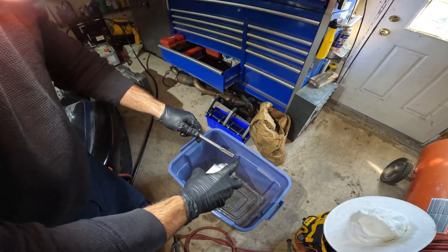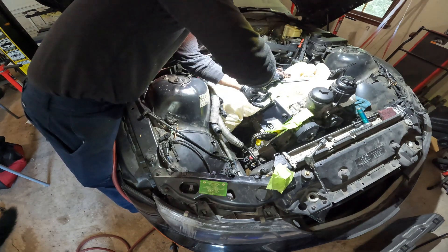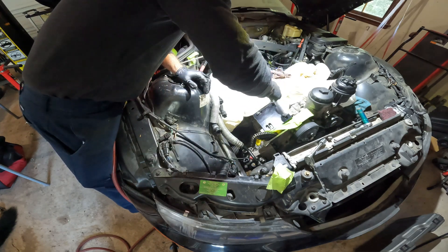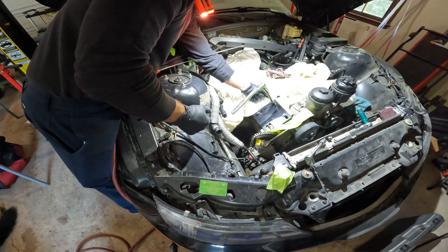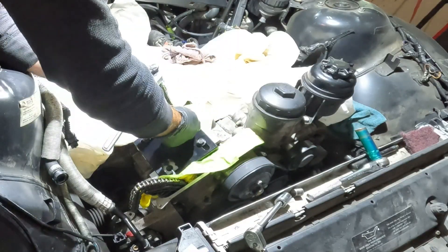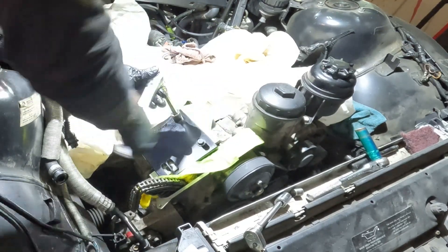On your tap you want that lubricated as well — each time you run this down, lubricate it. The next step is to tap the hole. The guide again helps keep you straight — make sure you're all the way down. Using that 11mm socket you can feel it just kind of pulls right in. On this tool there's a line, and you want that line to line up with the top of the locating tool — that's the depth you want. I'm going to cut new threads in about three steps, going up a little bit at a time to clean out the swarf.